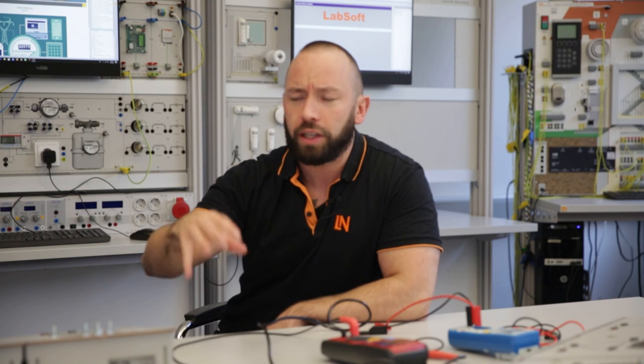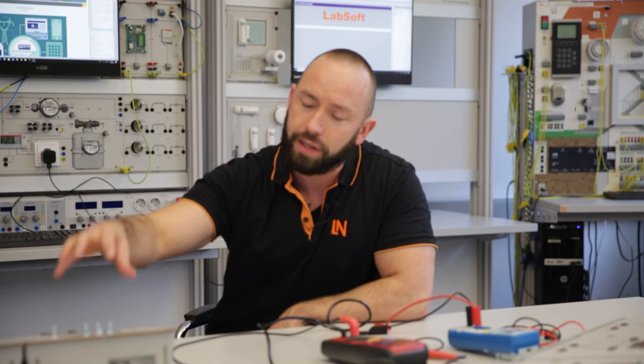You can say that with a delta connection you can create more torque and more power, so an electric motor in delta connection is better for getting the maximum power and maximum torque out of it. On the other hand, the star connection guarantees a smoother running of the engine and is easier to control — you don't need to worry too much. With the star connection you consume less power, but with the delta connection you have a higher power output. It just depends on the strategy of the car manufacturer.